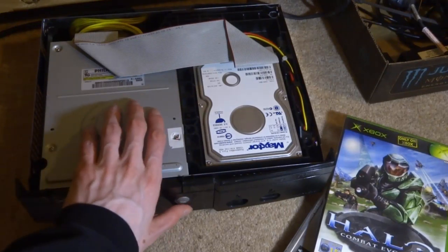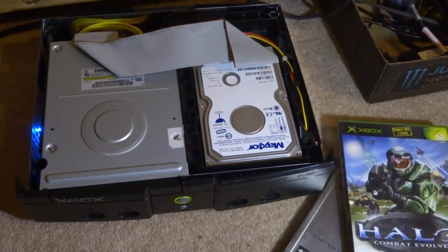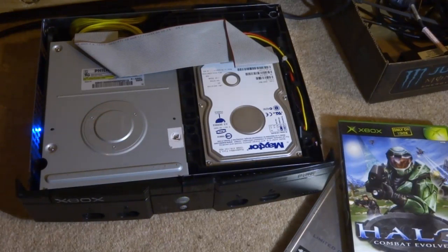Let me just go and power on my Xbox — as you can see it powers on normally. If I wait about 30 seconds and then try to open the disk drive, it just doesn't open. The button flashes and the disk tray just doesn't open at all — it doesn't even seem to attempt to open, which is a bit strange.